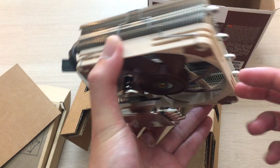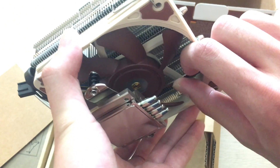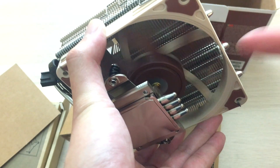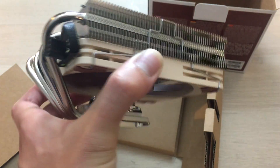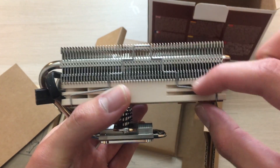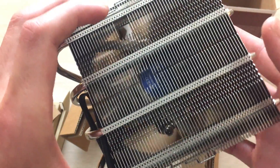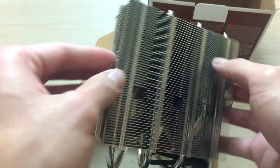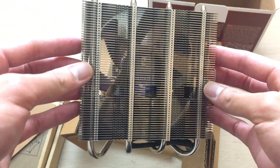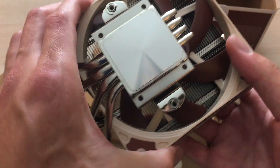You can immediately tell it's a really high-quality product. The plastic on the fan is super tough, unlike most cheap fans — you can't even really bend the blades much, even though they're super thin. It's got reinforced construction on the Noctua NF-A12X15 fan. This is their new slim fan and it's supposed to perform pretty well. For the heatsink itself, it's a relatively sparse fin array, probably because they're planning to make this a super quiet cooler, so they didn't want to use a high RPM fan to push through a dense fin stack.